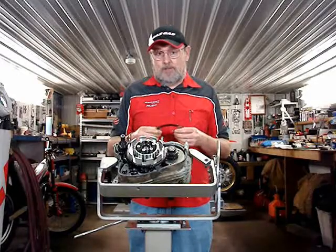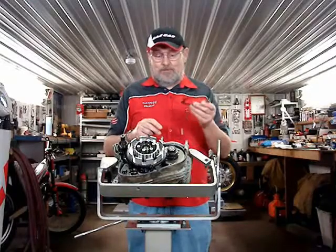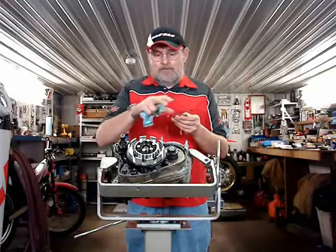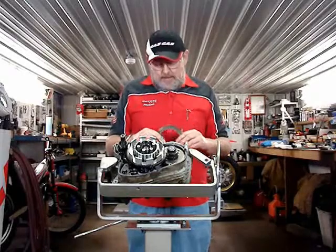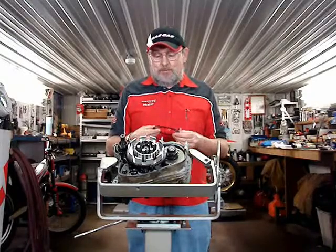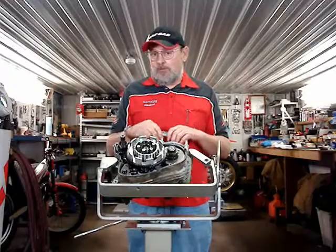We here have a machined piece of granite that's for scientific checking for flatness, and you just put it on the flat surface plate and tap on it, and if it's warped at all, it'll click, it'll rock on that surface. Some people use a piece of glass, but it has to be a pretty good piece of glass. So that's why we say when you're replacing the clutch, you should put the whole thing in, a complete genuine part.